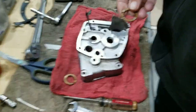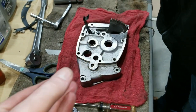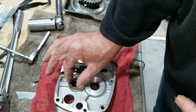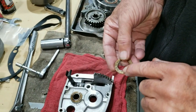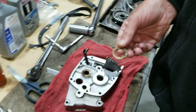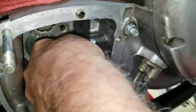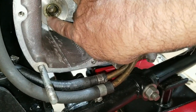After getting the spring on there, we're going to put these copper-bronze type bushings — thrust washers, that's the proper term — on here. We put a little bit of grease in the bore for pre-lube and grease on the backside so it holds in place and won't fall off; it'll dissipate when the oil gets in there. The flat side goes to the alignment pin — that's got to go through the hole.